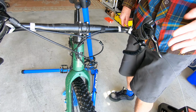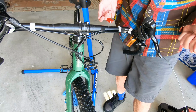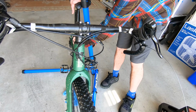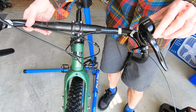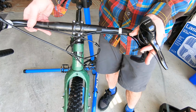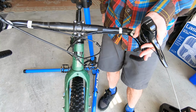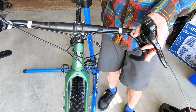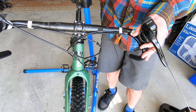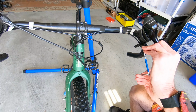Okay, so we've got our cable cinched, and immediately upon actuating the lever, chances are that it's basically going to go slack. That happens virtually every time, because that's how you figure out how to actually tighten the cable, by actuating it a few times and stretching that cable out. No different than any shifter cable situation where the cable might be caught somewhere or kinked. So I'm just going to work this lever about 10-11 times, and then I'm going to loosen that pinch bolt, and then retighten it. I've kind of pulled it taut again.